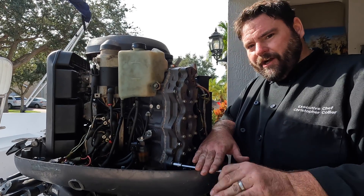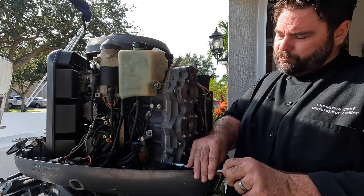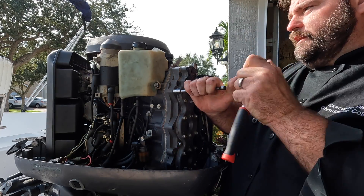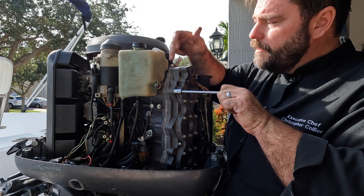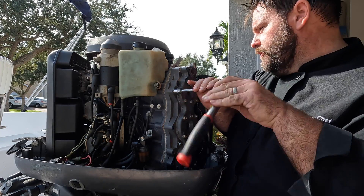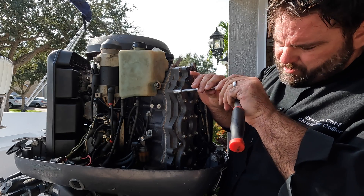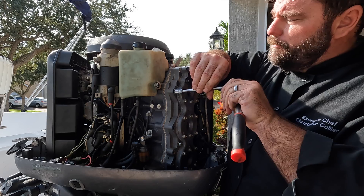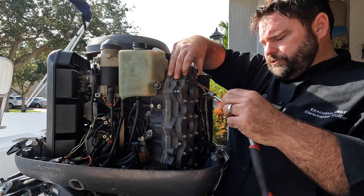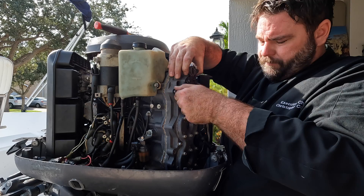We're down to the last couple of head bolts. Like I said, I like to do them by hand - once you bust them loose you can pull them out with air tools or an impact if you want, but I want to make sure you don't snap the bolts. Right here there's a groove where you can fit a pry bar or a big flat head, and you need a dead blow hammer to knock the seal loose on this head. Mine's actually coming right off - that's beautiful. I don't even have to beat it with a screwdriver to pop it loose. The head is already loose.